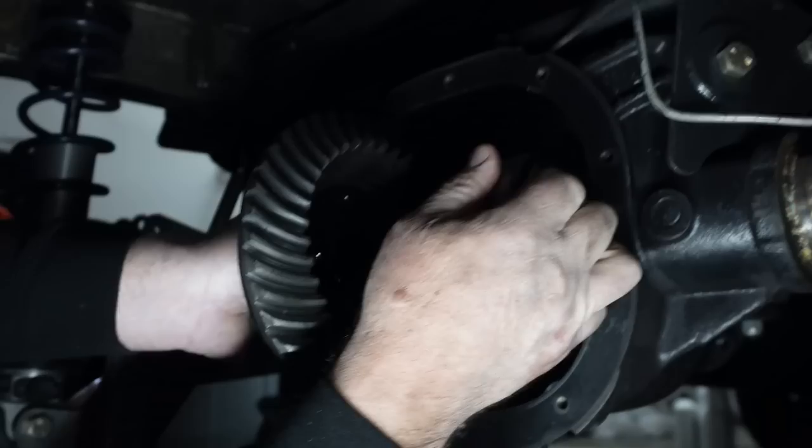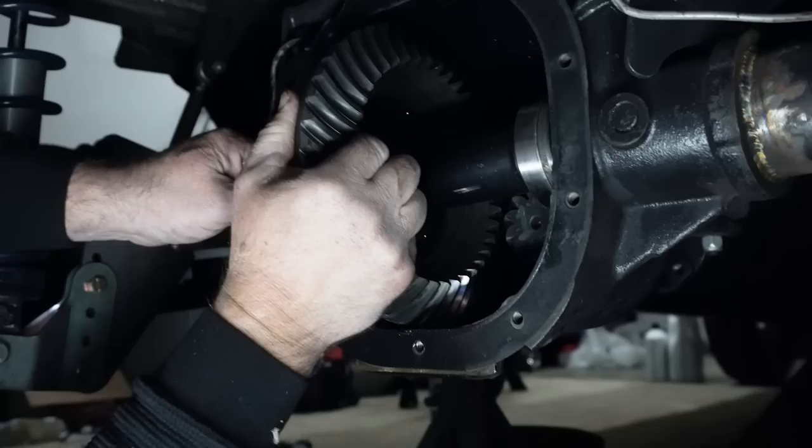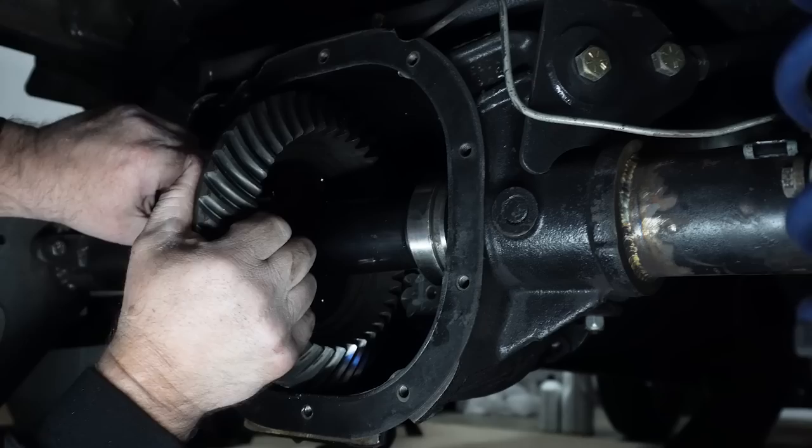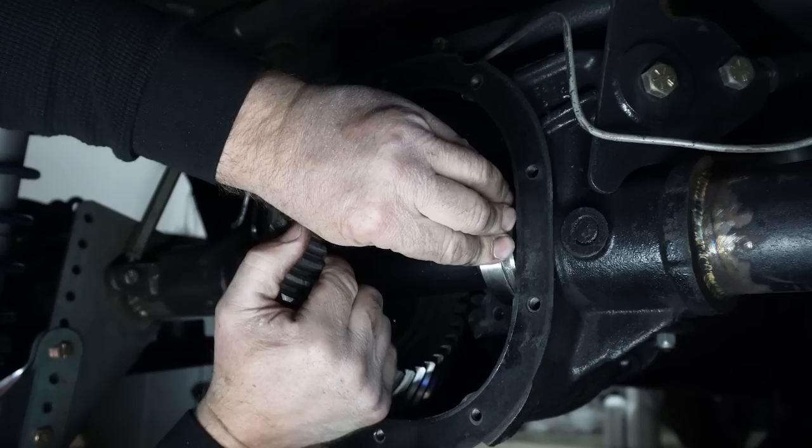Axle. So we took the stick shift all motor car, it had 430s in it. Oh no, I lost our light. Take two. It's just dark. What were you saying? Our stick shift car had 430s in it. The stock motor that's in here now doesn't really want to rev as high as that one did, so putting 373s in, if they'll go.